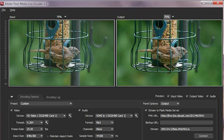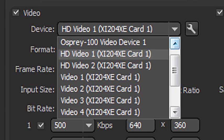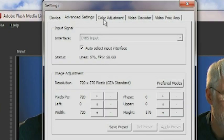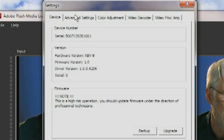If you open an application like Flash Media Encoder, you can access any of the four audio devices, and the video choices will include the two HDMI and four composite inputs, labelled as Video 1–4 and HD Video 1 and 2. Clicking on the Settings button will open the capture filter where you can configure the selected input channel. You can only change the settings for one channel at a time when the dialogue is open, so if you wanted to change a setting like de-interlace for all inputs, you'd have to select each channel in turn, open the dialogue, change the setting, and close it before moving on to the next one. Unfortunately none of the controls are interactive, certainly when using Flash Media Encoder, which does slightly limit their usefulness.